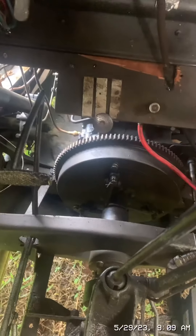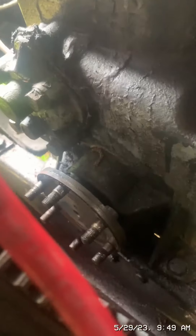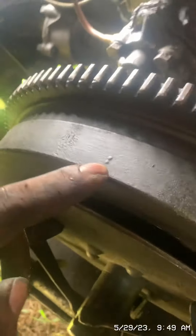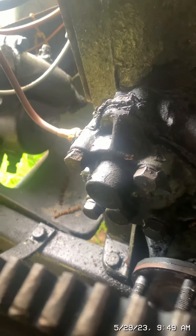I have the little mark at top dead center. Now I'm going to take off the flywheel. The flywheel is removed — I had to loosen the spicer joint right there, pull off the clutch plate things, pull loose the clutch plate, then loosen the bolts on the flywheel, making sure the center mark is at top dead center. There's the oil pump right there. Now I can loosen these bolts, pull it all the way off, replace the gaskets, and put everything back together.